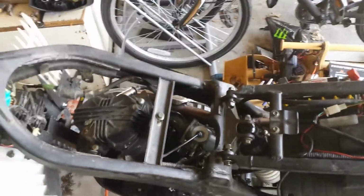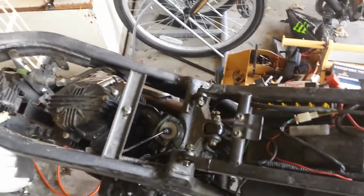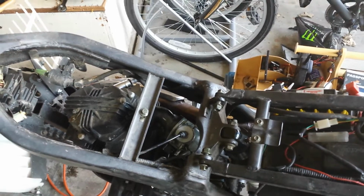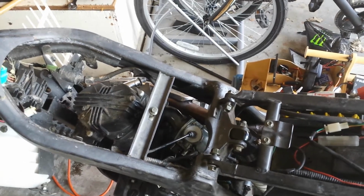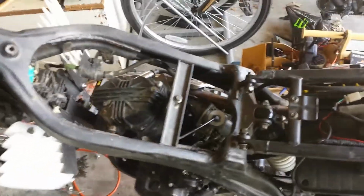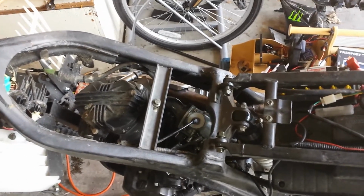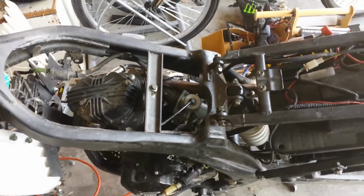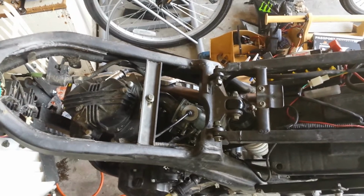The carburetor has no external adjustments other than the idle air screw. Also, the heads of the bolts attaching the carburetor were actually shaved off at the factory. And there was a rivet holding the top cap on, so I had to drill that rivet out without drilling through the carb body. I had to cut slots in the bolts on the bottom so I could unscrew them with a flat tip screwdriver. I used a Dremel on the bowl bolts and just a regular drill bit on the rivet.